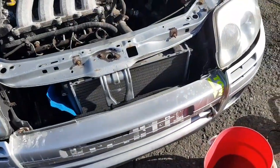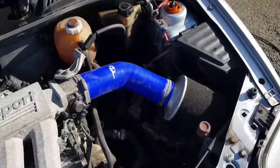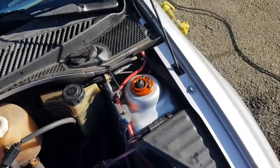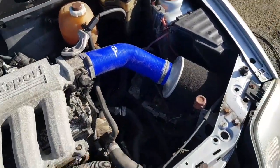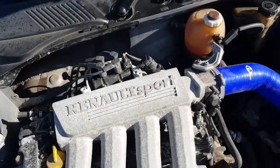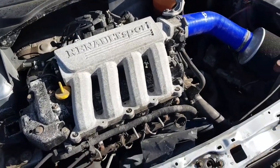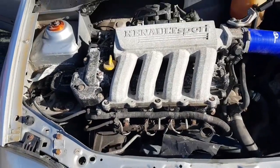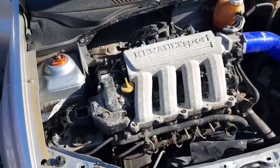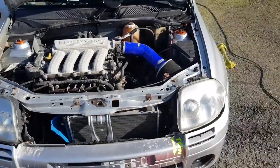So you've got a new radiator. Well, it was new about 4 or 5 years ago. In the engine bay, as you can see, we've got obviously decent quality top mounts on there, fully adjustable to get a decent setup for the track. A little intake. Engine bay is looking a little bit scabby, but we'll get to that. So we've basically bought new plugs, which I've already put in this morning, and a new aux belt on these Clios. If you know enough about them, the aux belt can be a bit of a nightmare. These need changing every 3 years. If the aux belt lets go, 9 times out of 10 it'll wrap around the timing belt and snap the timing belt. It's a common thing on these Clios, so always be aware of that.